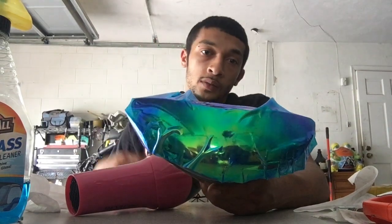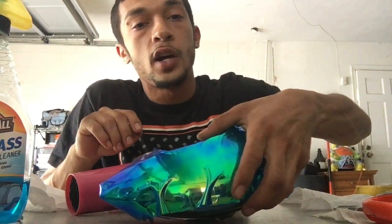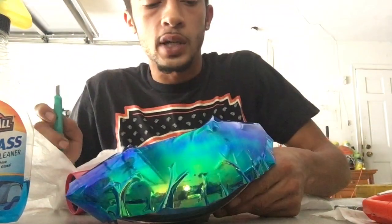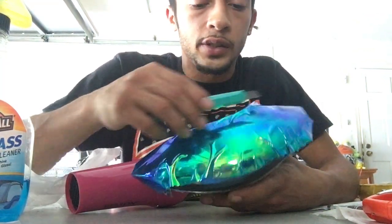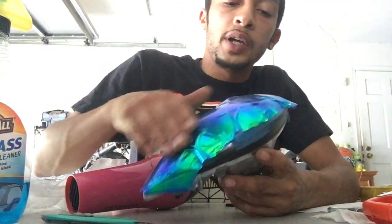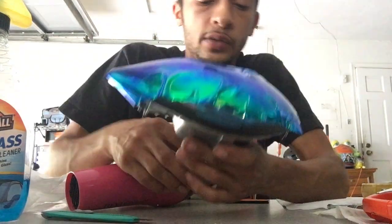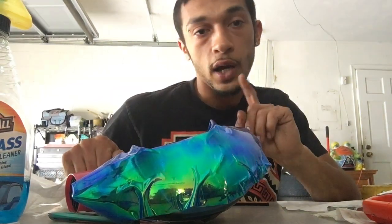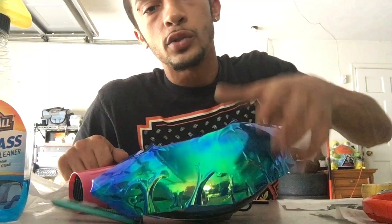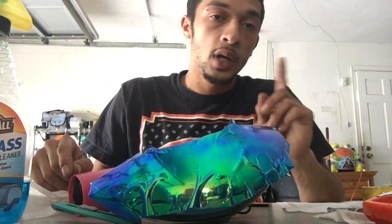That pretty much sums up how to do it. I'm gonna cut the video here so I can finish it off properly — I just want to do it one time right. In the end, make sure you take all the air bubbles out, get a nice clean cut with the razor along the trim edges, then spray some window cleaner and clean it off for a really nice shine. I appreciate you guys watching — make sure to subscribe, like, and comment. Stay tuned for an update video tomorrow showing how the neochrome looks on the whole scooter, including the headlights and brake lights. Thanks for watching — peace!